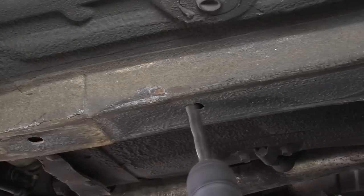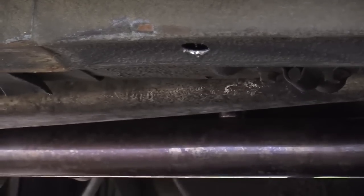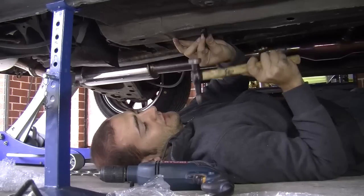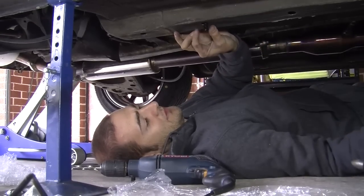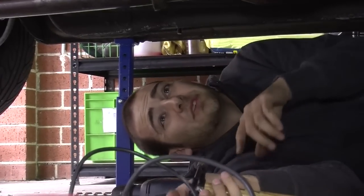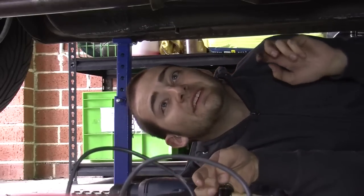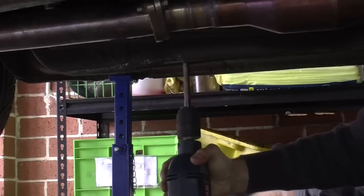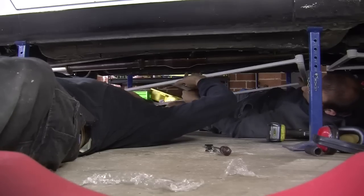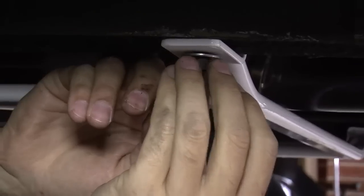The rear chassis rail mount holes needed to be widened just enough to get the captive nut through. The bolt holds the brace in place, with most of the forces being exerted on the side of the chassis rails. If you're going to drive around with two millimetres of clearance with your awesome coilovers or your airbags, remember that these rails are holding your car together, and if they get completely hammered they stop holding your car together — and that's bad. A small amount of encouragement from a hammer and the rear mounts are done. The central brace can then be lifted up under the car. It will need to come off if we're ever changing gearboxes or exhausts, but it's only a few bolts and easily removed.